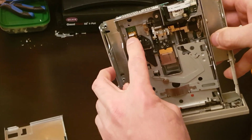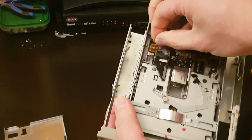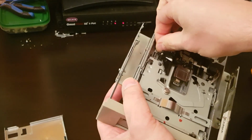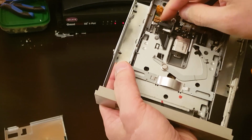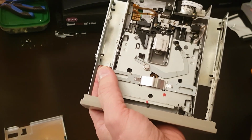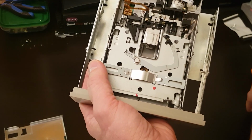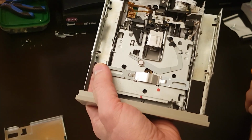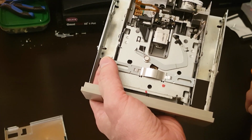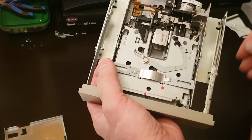So there are two cables here that connect both heads to the controller board. So I took them both out like this. I'm going to leave them out because it doesn't matter anyways. Then I put a disk in and it said not ready. So I put the bottom one back in, and I did DIR. It accepted the disk. It showed a directory listing, and okay, so presumably that's good. Then I plugged the other one back in, no change at all.